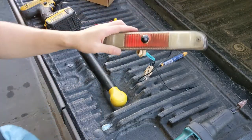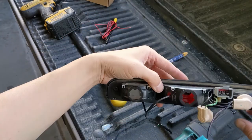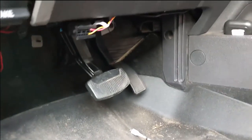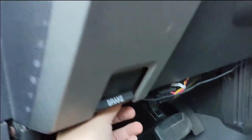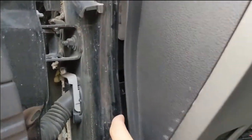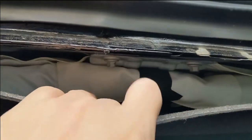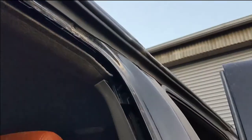Now that we've got a working camera assembly, I'll walk you through how I routed the wires in the truck. I ran my wires from my head unit under the steering column and secured everything with zip ties. In order to get the wires from the kick panel to the back of the cab, I pulled back the weather stripping to give me room to run the wires. I didn't have much trouble routing the wires — you might need a coat hanger and some tape to pass the wire through, but I didn't. On my truck, I didn't need to drill any holes to pass the wire bundle through.